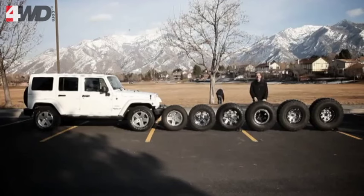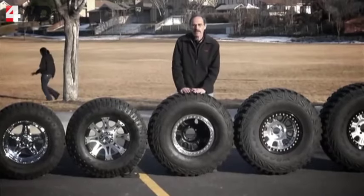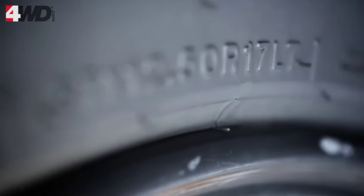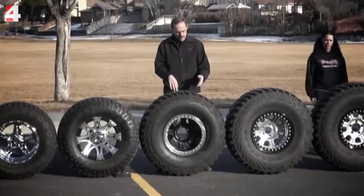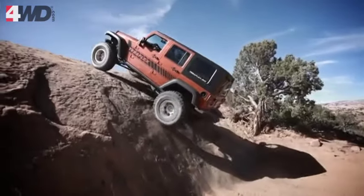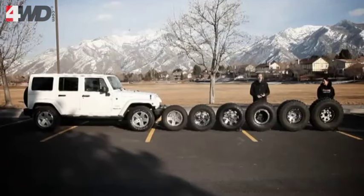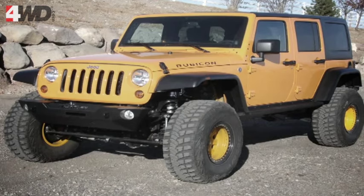Next up is the 37s. 37s are a popular tire. The 37 refers to the overall height of the tire, then we've got 1250 wide for the width, and a 17-inch rim. Now when you get to a 37-inch tire you've moved up to the next level. You're going to probably be looking at doing some gear changes just to get the power back. If you start turning a tire that big around, you'll feel some power loss and it's going to affect your gas mileage. But when you get off-road, that 37-inch tire is really going to perform for you. 37s are going to require a three-inch lift — we've done 37s on a three-inch lift but they're tight. A four-inch is a lot more comfortable fit with a 37-inch tire.